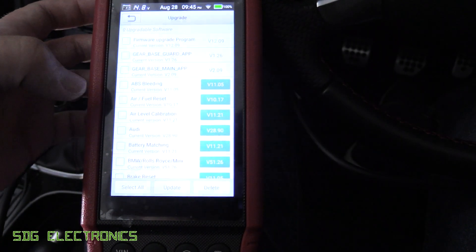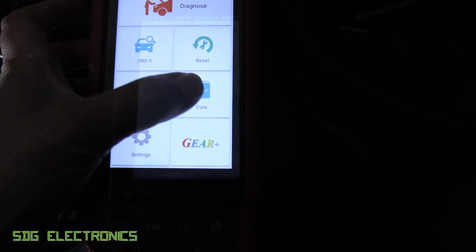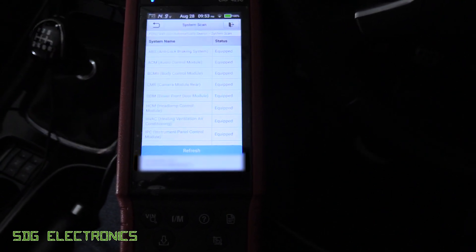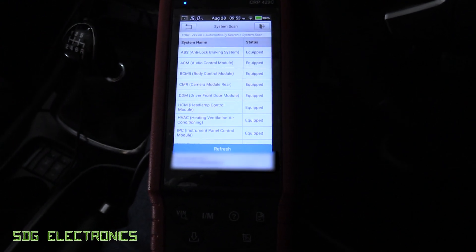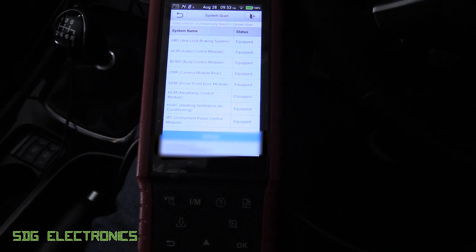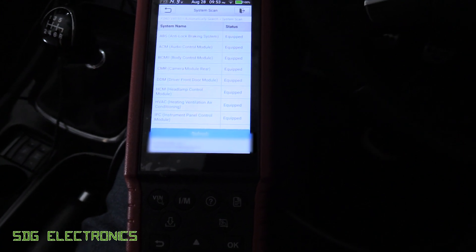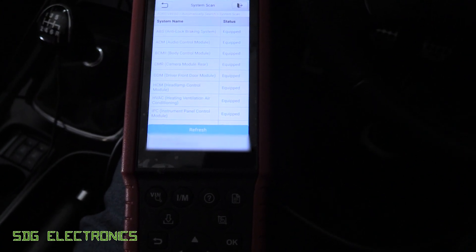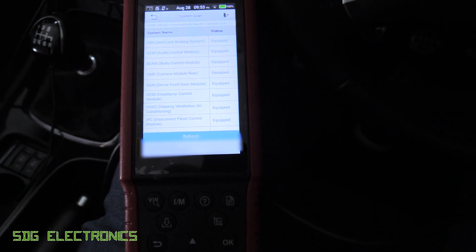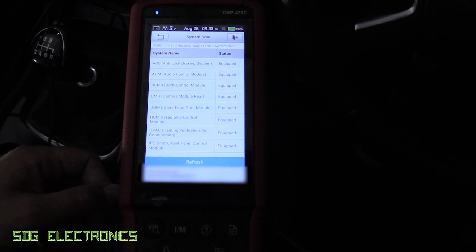Upgrades - it's got all of the things that we can update. I think they're all at the latest - zero upgradable firmware. I updated this earlier today. But overall, it does seem to be a really nice unit. It just seems to have a bit of trouble with certain vehicles. As you saw, it took forever in the BMW at detecting stuff, absolutely no problem in the Ford. I think that seems to be the case with many scan tools - some of them do have problems with certain vehicles, often just a very specific vehicle of a certain age group. It might just have an issue with the E90 series of vehicles from a certain build range, just because they used a certain ECU. But anyway, that's the CRP429C - I'll put a link in the description below. I hope you enjoyed the video.